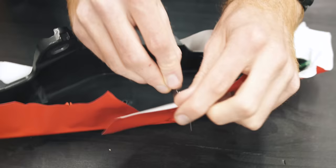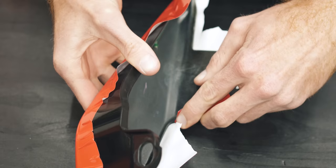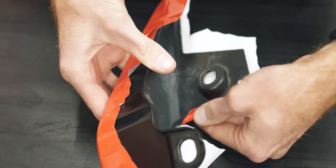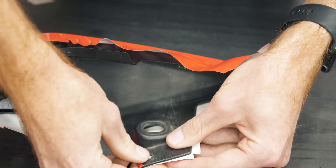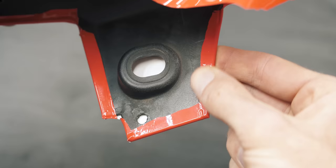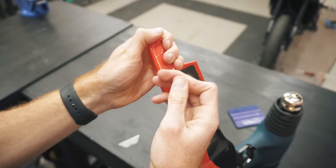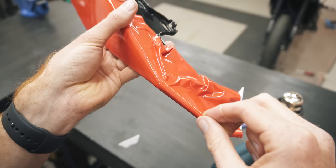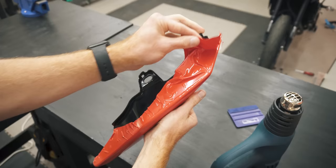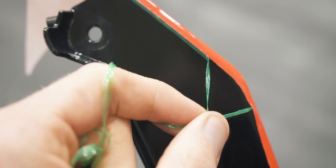Once the front of the panel is covered, you'll need to work it over the edge and around back. This is the most important part. I like to trim all but a few millimeters off in the shape of the panel and then fold it over the edge as smooth as possible. Make sure there are no creases where water and dirt could get under the vinyl, because this is where it will start lifting. The back doesn't have to be pretty because you won't see it, but it does have to be sealed from the elements. Now to pull the cutting tape — ensure your vinyl is well stuck over the tape, then use the filament in the tape to make the perfect cut. The excess can then be removed, and gently pull out the remaining tape from under the vinyl without stretching it. Be sure to stick down the vinyl that was over the tape.